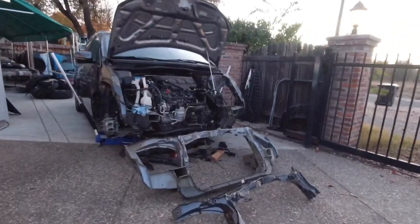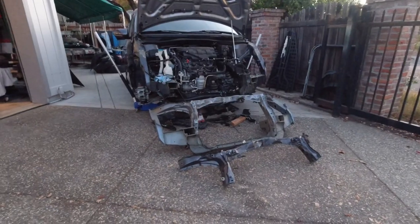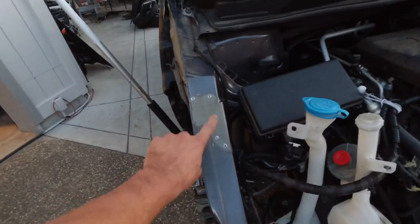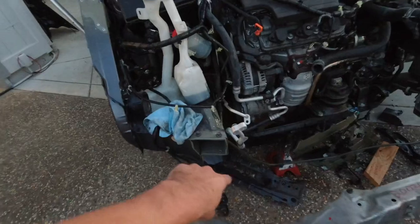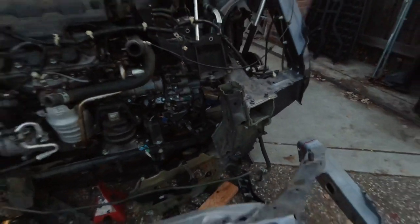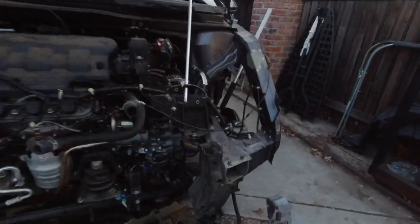Alright guys, and the front reinforcement is pretty much all cut out and drilled out. This is the top section right here, and I ended up just basically chopping what I could, and then it was easier to get to some of the spot welds. So I got this one drilled out, the spot welds, this section removed, and then the top section here as well. And then this one, I'll get it done before the next video, because I gotta run to work, you know, duty calls.